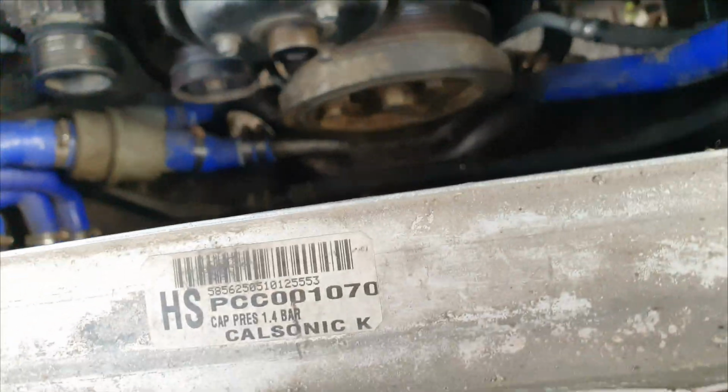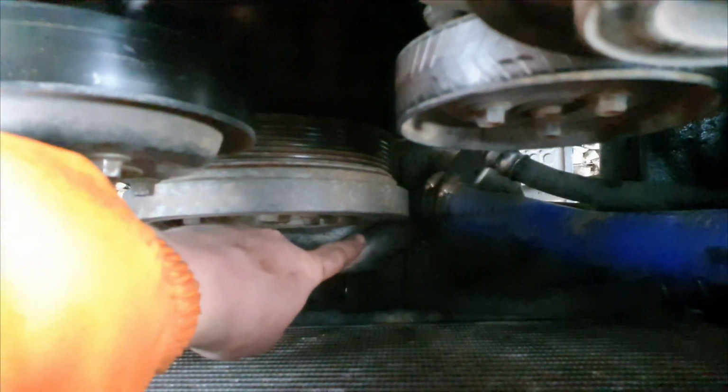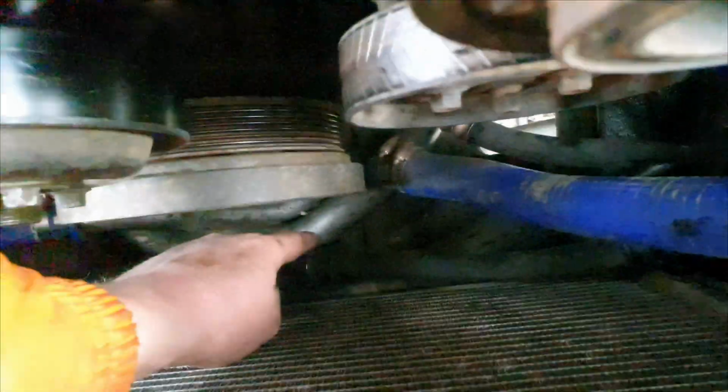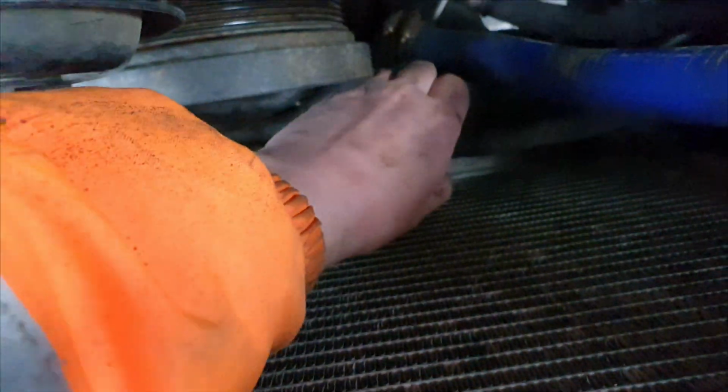Okay, so I've been underneath the car. This bracket here, you can get to it from underneath. Just reach your hand through the plastic skid plate, whatever it's called, and you can just about get an open-ended 8mm spanner on that nut there without taking the bracket off for that water pipe there. So this pipe and this pipe underneath are now free.